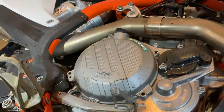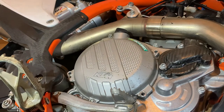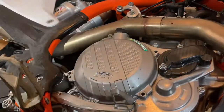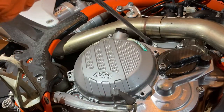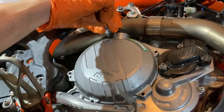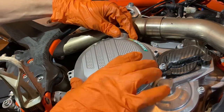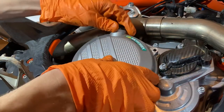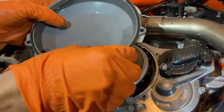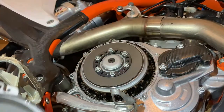As always when working on the engine, make sure it's clean because any dirt getting in there goes into the drivetrain and transmission of the engine and will gum it up. Clean it off before you take off the cover. There are no washers underneath these screws. Pull this up — there will be a gasket, it's a rubber gasket so it shouldn't break, but if it breaks it's time to replace it. There's your cover, and the gasket fits into this groove inside the engine cover.